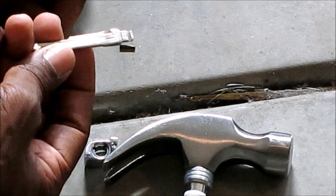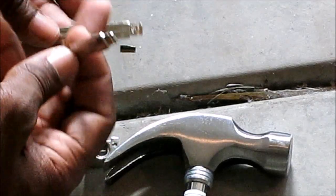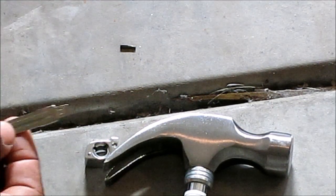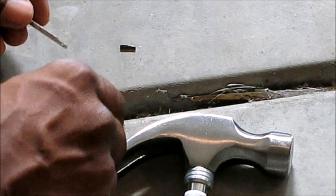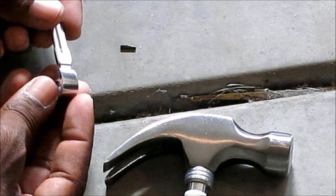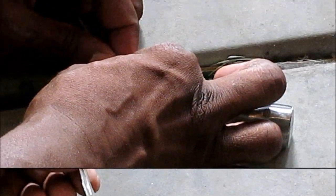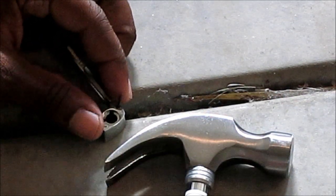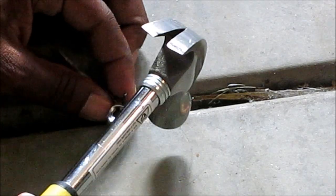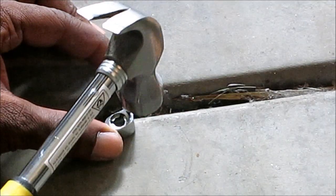And for a Hyundai Elantra, it's number 33. But the key fob's going to come with 2, and the one that was in there was number 15. I think that's bigger, for a Hyundai Sonata or maybe another Hyundai car. Alright, so once you put in the 33, remember the notch facing outward towards the smooth edge. Pin, let's see if I can tap that down some. I could even put it on a flat surface for a little bit just to get it started.